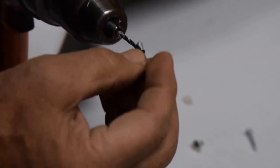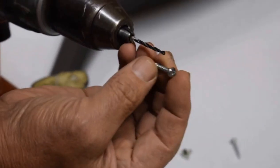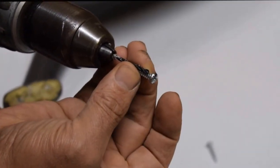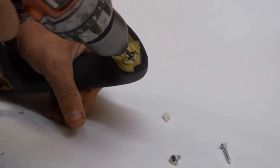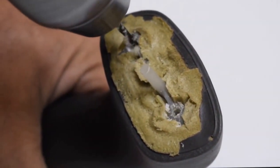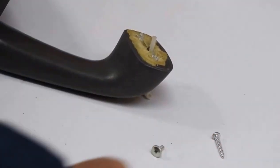This should be a pretty good sized drill bit. You don't want to drill out the threads — it should be the size of the shank or slightly smaller than the screw. So here it is, we're going to go ahead and drill these out. There's a little bit of material in there, not very much, it's pretty easy to drill.